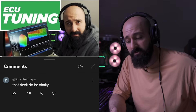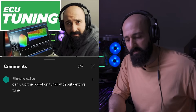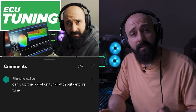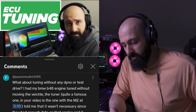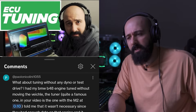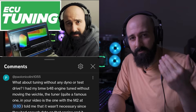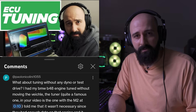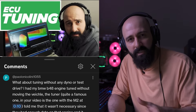Chris the Crispy asks about the shaky desk — it's a cheap IKEA dining table. Also asks: can you up the boost without getting it tuned? Yes, you can mess around with the wastegate spring and get more boost, but you're going to end up running lean and eventually blow up. Another comment asks about tuning without a dyno — someone had their BMW tuned without moving the vehicle and the tuner said it wasn't necessary. It's possible using an off-the-shelf tune downloaded online; you just hope it was rigorously tested and that your altitude and fuel grade were taken into account. Usually those off-the-shelf tunes are conservative enough to allow for some variation.